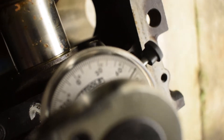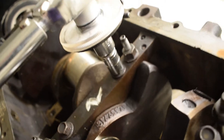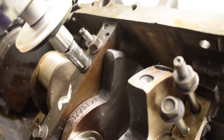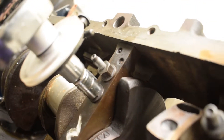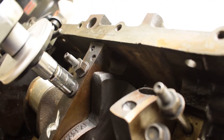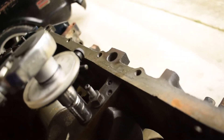I find it a little bit easier to use this tool — it's got degree markings on there and whatnot. I find it easier for the two inner bolts to use an actual shorter socket. They're easier to do on the outside, but the outside's got the little studs on them so you cannot put a shorter socket on there, which makes it a little bit more difficult to torque them right. For the inner ones I think it's 80 degrees and the other one is like 53 degrees.